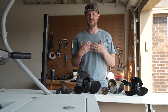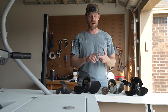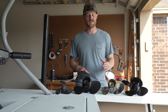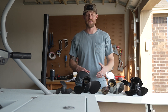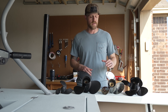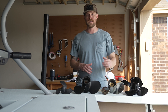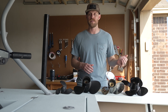Stainless steel — the prop I run on the back of my skiff is a stainless steel prop. Stainless steel props are great: they have great performance, they don't flex, they're durable, and they're corrosion resistant, so if you're using salt water, it's an excellent prop. The disadvantages of stainless steel are that they're expensive, they're heavier so they're not ideal for lower horsepower, and they have low impact absorption — so if you hit something, you're more likely to cause damage to your lower unit than to your propeller.